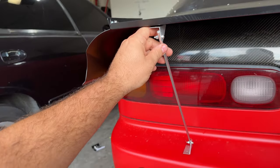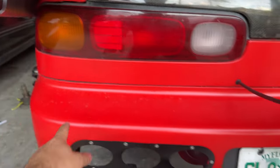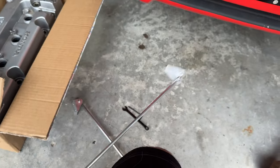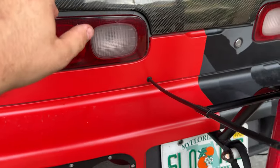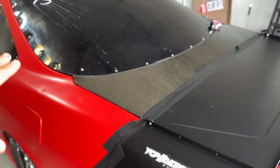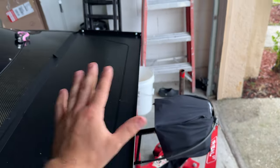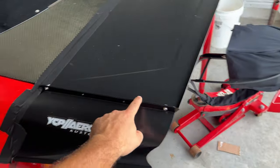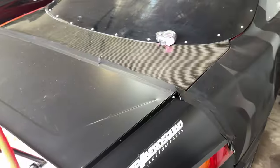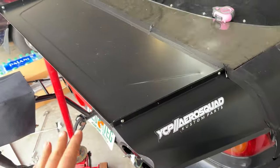Basically have it support the wing and then have it go down to the bumper, but I don't like that because the Honda bumpers are very flimsy. Right now I have it mounted with zip ties on the corner and then it has a couple studs going from the bumper support into the body. I feel like if you do it just with two rods supplied with the kit from the wing down to the bumper you're going to have issues.